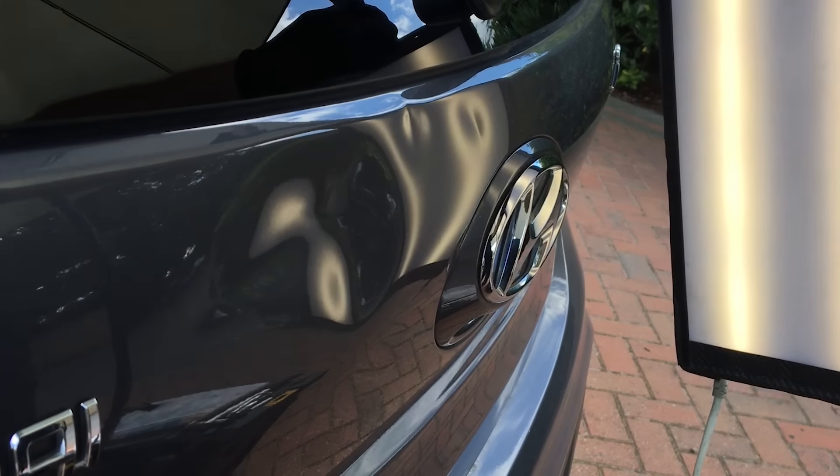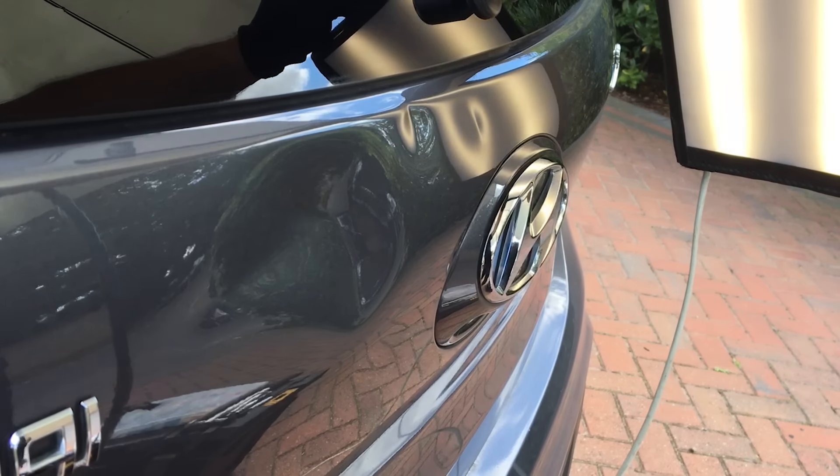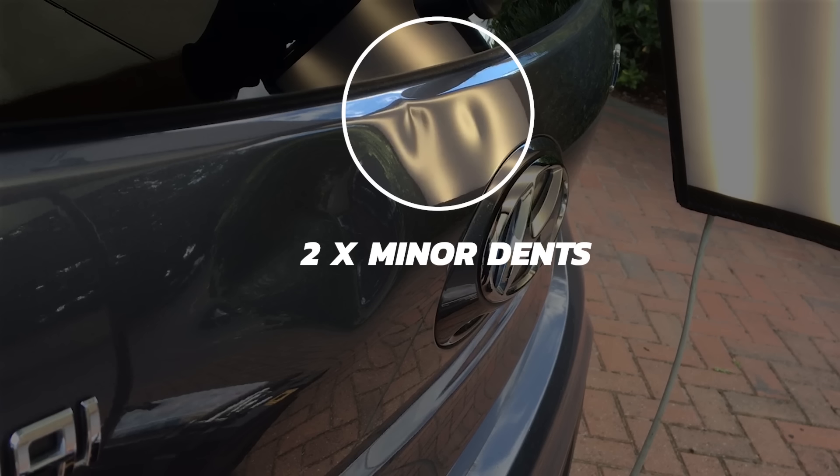So let's pan across all of this damage and look first at these two minor dents on the right hand side. The dent furthest to the right is a small singular crease, whereas the second dent to the left of this one is slightly more complex and looks like a couple of sharp impressions in one complete dent. This dent has pushed a bottom line upwards, as shown by this red line, creating an upward crease on top just in front of the rear glass.